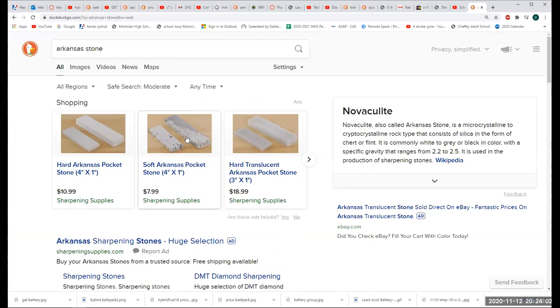It's like $5 at Harbor Freight. And what it's going to do is make it so that you're never tempted to do something stupid. Like Chuck, I'm going to do this on every flat gasket surface I come across. This is a habit I got into 30 years ago, because if something passes my eye test, it's going to show up on this if it's an issue, and it's going to keep everything straight, square, and flat. Don't rock it, just keep it flat.